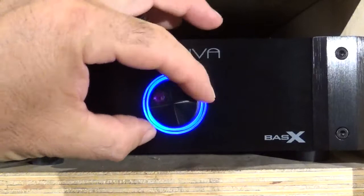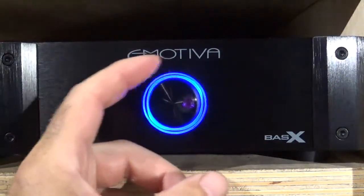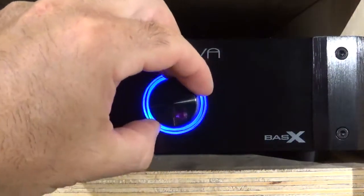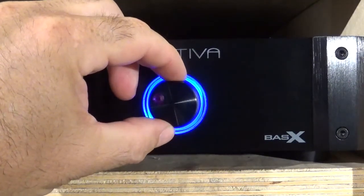Stick it on the knob. What you need to do is turn the knob as far as it'll go counterclockwise, then stick it on in the 7 o'clock position. If it's in the right place, it should be at 5 o'clock when you go the opposite direction. With my HiFiMAN HE-560, about 9 o'clock is getting pretty loud and 10 o'clock is very loud.